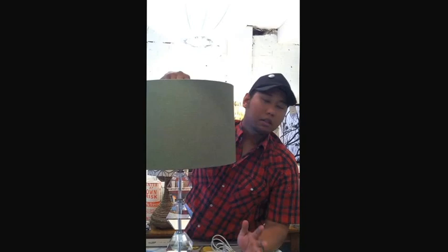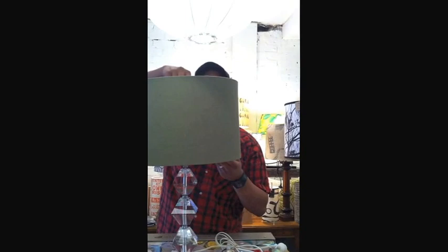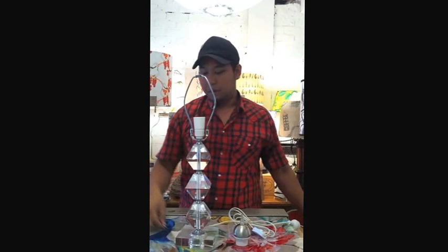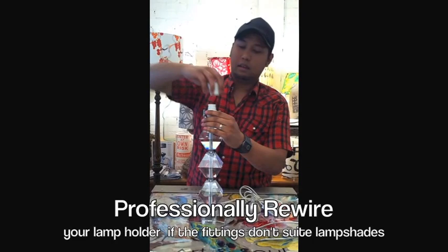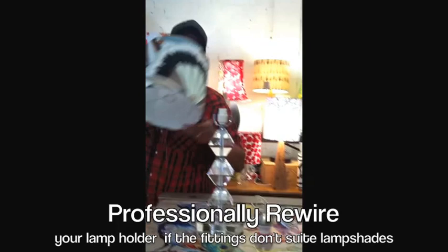The thing I don't really like about finial fittings is they're quite loose, so once it's screwed into place it's going to be a little unbalanced and a bit wobbly. The best way to secure a lampshade onto a lamp base these days is to screw it from the base or the lamp holder here. You might say the harp's in the way — they're a fantastic design. All you do is move these two bits up, pinch the bottom and it slips off. Now this basically turns into a standard fitting. Take that harp off, take the screw cap off, and we'll secure the shade on top.